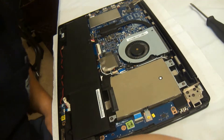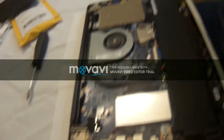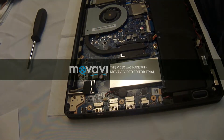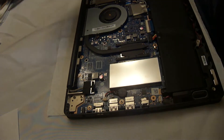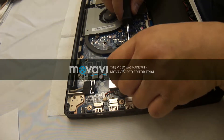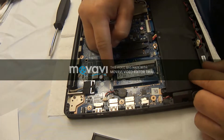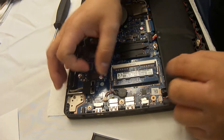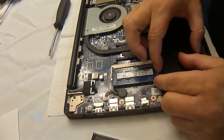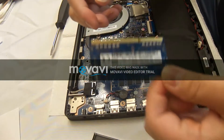If that's all you're installing, good to go. If you're going to do the memory, it's on the other side — it's actually a lot easier. Memory is just one stick that's removable. On mine I had six gigabytes total: two gigabytes removable and four built-in. You pop off the heat shield or dust shield very carefully by sticking your pry bar under that little slot, and it comes right off. Make sure you remember how it was aligned. There are two clips that hold the stick in — push them outwards, tilt the stick up, and pull it out gently.